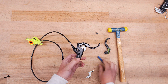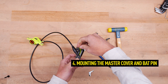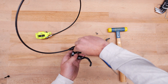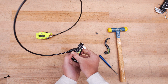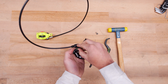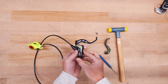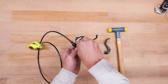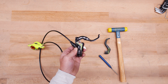Now attach the cover and the BAT cover in reverse order. To do this, clip the cover in on its longer side and press it down. Now pull the lever blade slightly and push the cover through the master. Mount the spring and make sure that the bayonet catch is correctly aligned with the broad side facing downwards. Push the bayonet catch downwards and lock it by turning it through 90 degrees. Before using the brake for the first time, check that it's functioning safely.